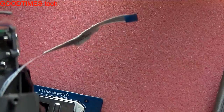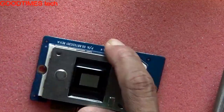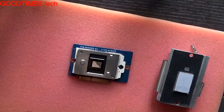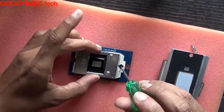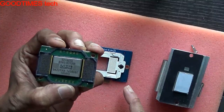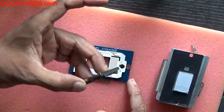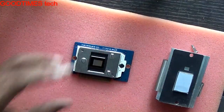There is no other problem with the lenses, mirrors, or lens inside. If the DMD chip in your projector is fine and there are no dots on the chip itself, then you can disassemble this whole assembly and clean all the lenses one by one and replace them if needed. For replacing this DMD chip, just unscrew it anti-clockwise. You can get the chip on many online websites. I can't replace it now because I need approval from the client — if the client approves, I will order online and paste the link in the description.